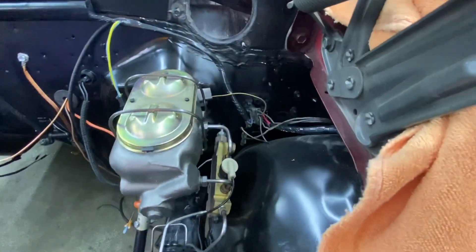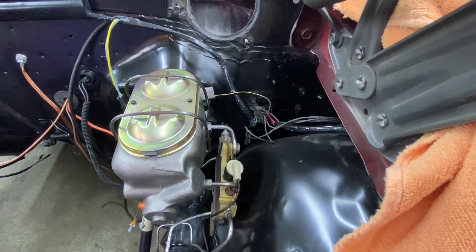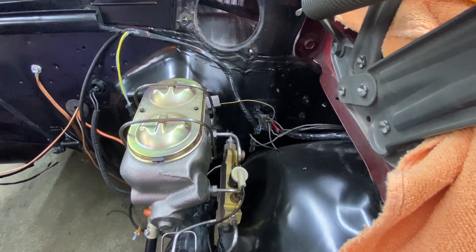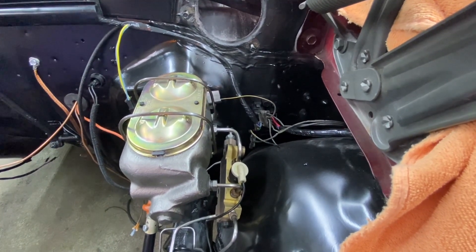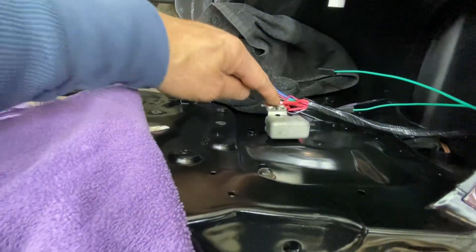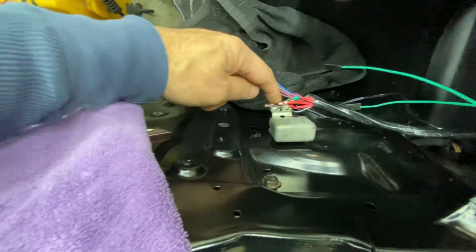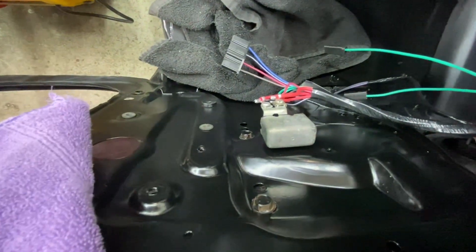The wires run all the way up to the plug and up to the dashboard. Now it's not a true ammeter in the sense that all current runs through it — it's only measuring a portion of the current. Most of the current travels through the main circuit coming from the alternator, going back to the battery to charge it, and that's what it's actually measuring.